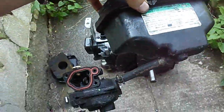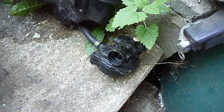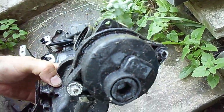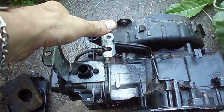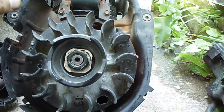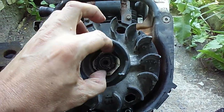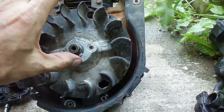The gas tank slides in those slots — it's kind of one unit together with the carburetor. It looks like the carburetor has some screws in it, so the top will come apart from the bottom. Next would be the flywheel nut, which is rather difficult because there's sheet metal housing around it now, but I've already undone it. You take off this funky-looking recoil assembly.